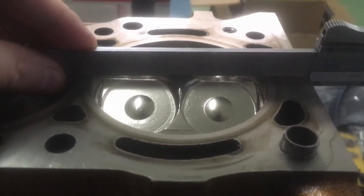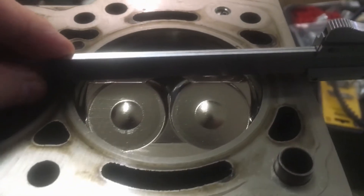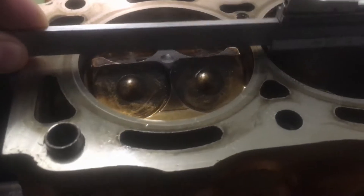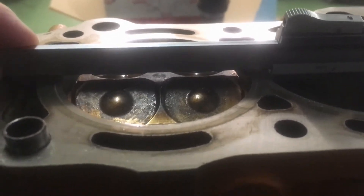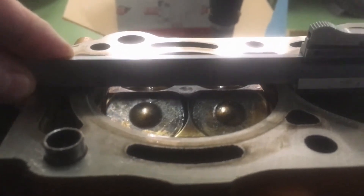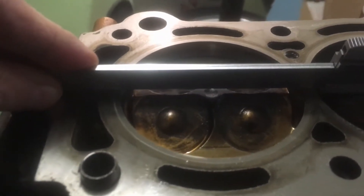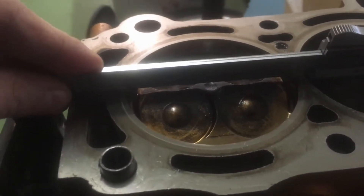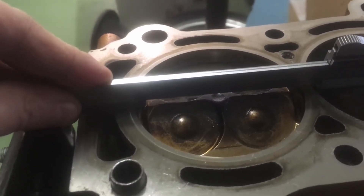At the center of the piston dome, the piston is against the caliper, so you get the idea how high the piston comes in the bore. If we look at the old design, it's sitting in the same position in the bore, and you can see that there's several millimeters from the top of the dome into the caliper. So even though the pistons look quite much the same, there are quite significant differences in the design, and it has taken three iterations to get the valve pockets — all the positions, the depths of the pockets — right.